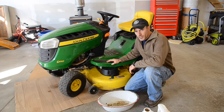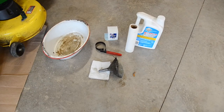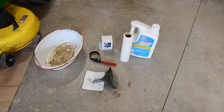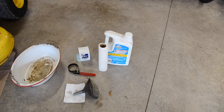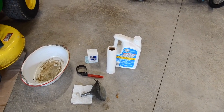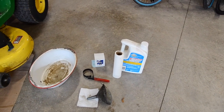In this video, I'm going to show you how to change the oil on a John Deere 100 series tractor. This is some of the stuff you're going to need: a filter wrench, a funnel, some type of pan to drain your oil into, and you're going to need some oil. Not that much oil. I only need about a quart and a half for this 110, and maybe some rags and/or paper towels.